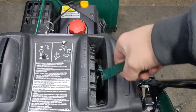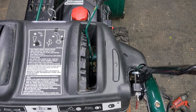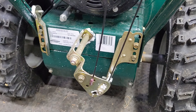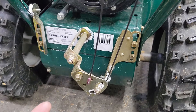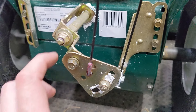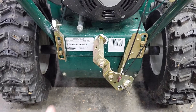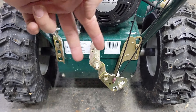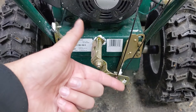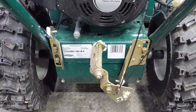Come back to the shift lever and put it all the way forward into the number six position — that will take some of the tension off the cable. Because we've established that this bracket rotates up when we put the machine into R1, what we need is for this bracket to go up even more, which means we're going to have to adjust this triangular bracket down so that this arm pulls up higher when we go into R1. The farther this triangular bracket is down, the farther this whole arm will lift up, which means the farther the shift fork will move the friction wheel over on the friction plate.